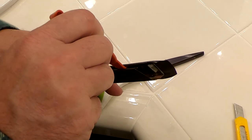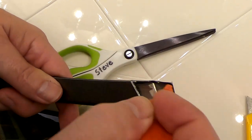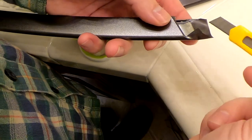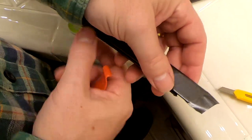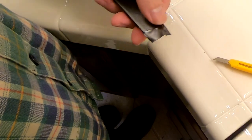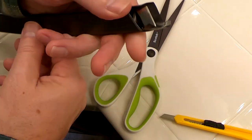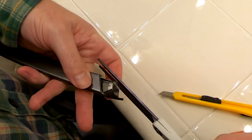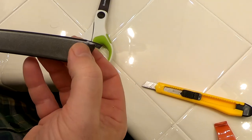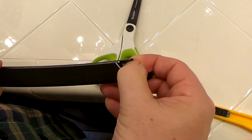All the money is in the corners — you'll spend most of your time working these ends, but this is where the reward comes. Work in the material and when you come to pinch it, there's just a tiny flap of material there. To fold it over, do the Christmas cut on the diagonal into the corner. Shorten the flap a little, cut the diagonal off to remove excess material, then fold it with thumb heat — this side's easy since you can get your whole finger around the back.